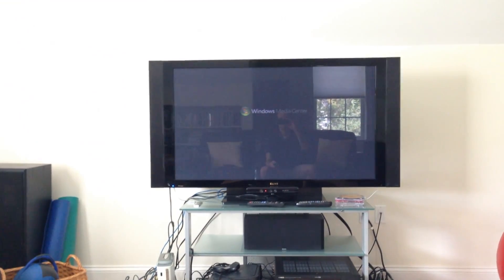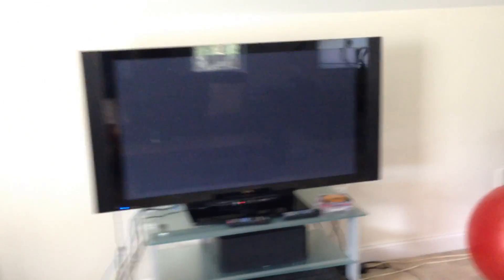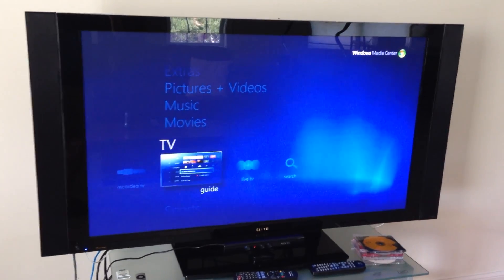The Windows Media Center extender on the Xbox 360 does take a little bit of time to load, so it's not quite passing the test yet for the family here, but I'm going to keep working at it. I also found that Wi-Fi doesn't really work all that well to the Xboxes, so you'll want to make sure you have a hardwired Ethernet connection. I tried some Powerline adapters and that didn't work all that well either — the Xbox was a little sluggish responding to remote control commands. So you're probably going to want to wire some things up, and I've been drilling holes through floors and walls, which makes me very popular in my house right now.